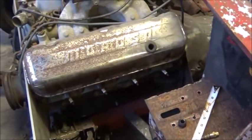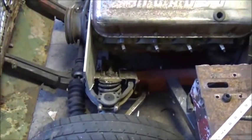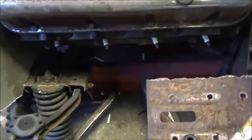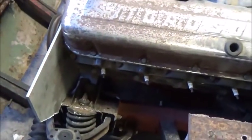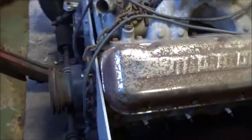The front of the engine's down now because of the way we got the car raked, so we're going to raise it up and change that some. Everything seems to be working out about like I figured it would. It's not going to be an issue getting our front end alignment right. Now one thing I am going to do, because I'm worried about strength, is the way these lower A-frames mount on — this bracket has one bolt that goes all the way through the frame, and I don't like that one-bolt situation. The way this is set up, you shim behind this to actually do the alignment on the car. Once we get the alignment where we want it, I'm going to weld them in, and we won't be able to change it without cutting it loose. It's the way I prefer because I do not want a three-eighths bolt shearing off.